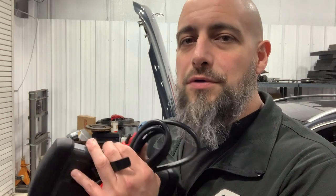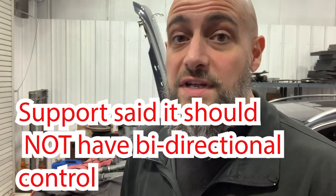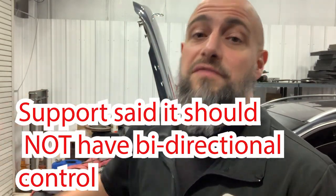If you're not a beginner and you've been a technician for 20 years or longer, this is still going to help you. I love a scanner that has bi-directional control so I can actuate something — but I also have access to wiring diagrams and know how things work, so I know how to make them actuate anyway. As long as I know what the computer's seeing, I know if the computer or the switch is good or bad. If you specifically need bi-directional control, you're going to want to go up a level. I'm not going to say this is bi-directional for all vehicles, even though we witnessed it in this one model. When I get the email back from Xtool, I'll put it in the comments and update the video.